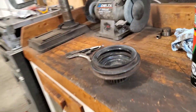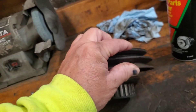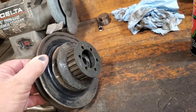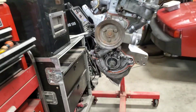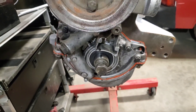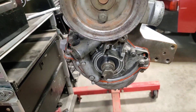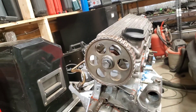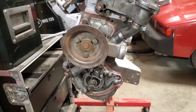This morning I want to get this pulley back on for the belts — the timing belt, AC compressor, and alternator. When I pulled this, I remember having a lot of problems because the bolt on the nose was extremely tight. I'll look up the torque specs. I've been using that bolt to turn the crank — it's snug but I don't want the crank to spin, because it's an interference design and you don't want open valves colliding with the tops of the pistons.